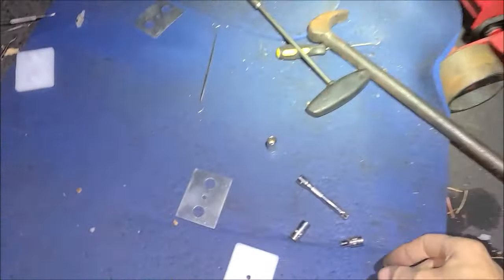Okay, so here's this bolt. We need to grind a little bit off of that, so you can see. We got plenty of depth of Allen wrench, won't be a problem, but if we don't, due to wear or whatever reason, that's just going to dig into that new bearing and tear it up. So I put a 9/16 nut on there, got it good and tight.